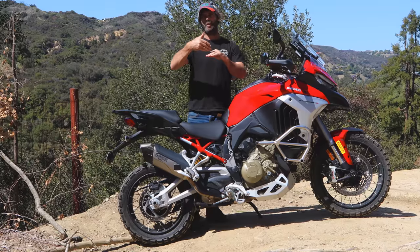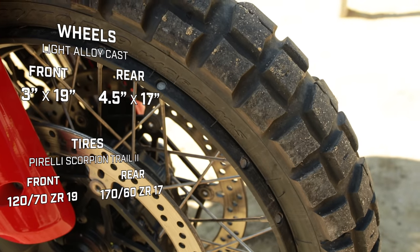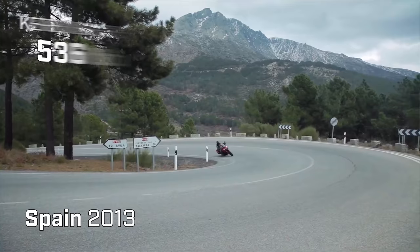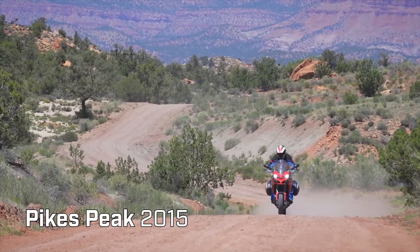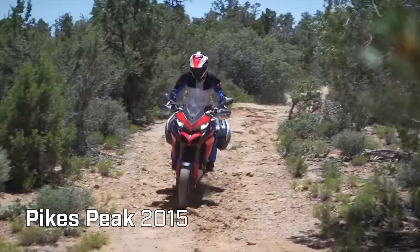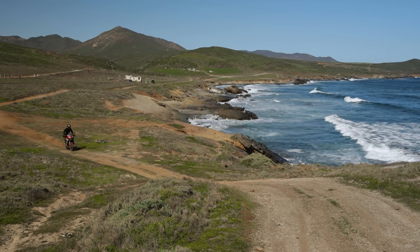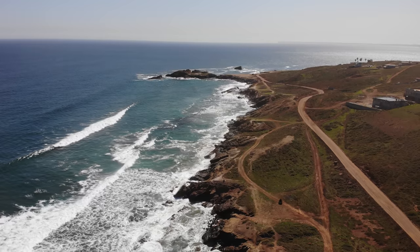The old model definitely had more weight on the front. The old model had a 17-inch front wheel — this is now a 19. They've also changed the size of the rear wheel, making it a little more narrow. So there's a lot more weight in the middle rather than over the front. The old Multistrada steered really well through the canyons, but off-road you had to be careful because of the smaller front wheel and more weight over the front. Ducati are also thinking about off-road riders with the mirrors — they've moved them further forward, so when you stand up on the pegs with your arms higher, you're not touching the mirrors. Just thinking ahead of what an adventure rider would want.